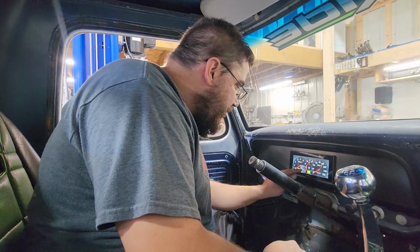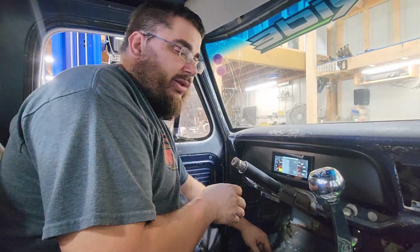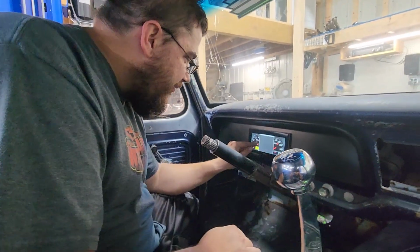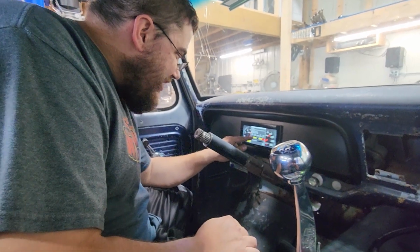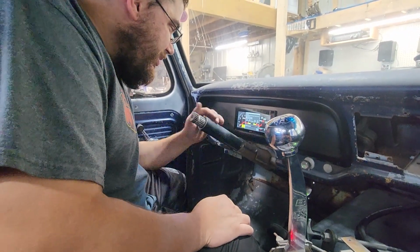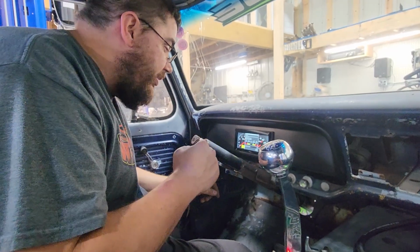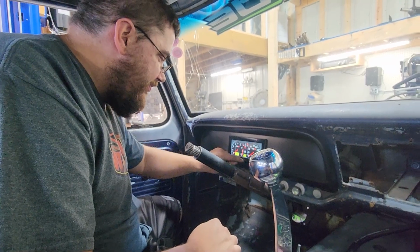But what I wanted to do was, you know, this thing was flashing yellow at times, and then it would go red. And I know I looked down and seen red a couple times. So where was the yellow threshold to the red? And that's what we're looking at. And looking right here, it's not looking very good. Low warning at 8 and low alarms at 1, meaning, yeah, it was yellow quite a bit. So it had 8 PSI of oil pressure or less, and then it had one a few times there. So unfortunately, that's not looking very good, not very good at all.